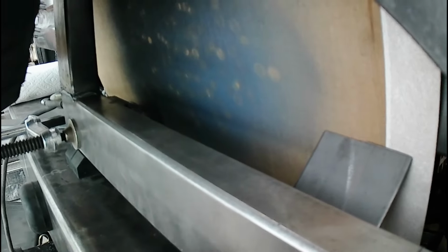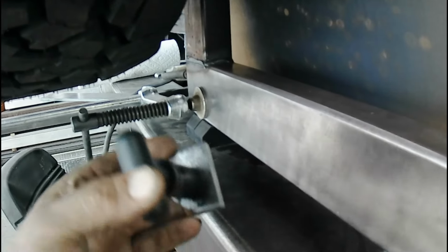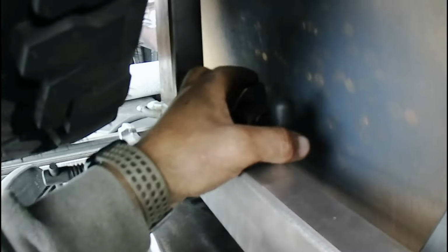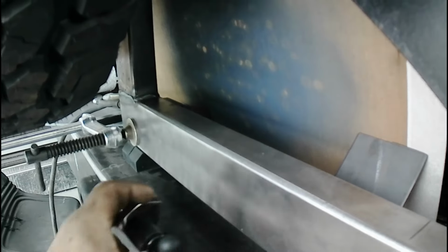So what I'm planning to do is to weld the tab back in here. I've got it clamped, pushing in on polyurethane mounts here. So when I get this mounted back in, the real crappy spot to video, it's going to be back in behind there, kind of a secret release or whatever you want to call it. But hopefully that'll hold it tight that way.